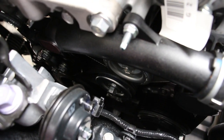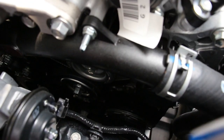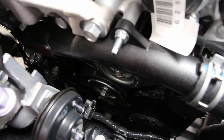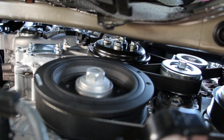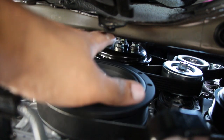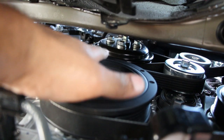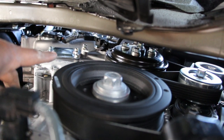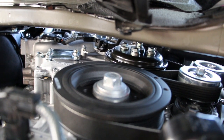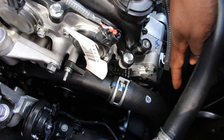Looking on the passenger side of this engine bay you can barely make out the drive belts. Down inside here is where your water pump is going to be, up at the front here is the alternator, and down at the bottom there's your AC compressor. This whole setup is best accessed from down below. Here's a look at the drive belt setup from down below — you can see the tensioner located over here which makes it easy to change the drive belt, but to get to the water pump you don't have much clearance. From down below you've also got this little window here to access the timing tensioner.